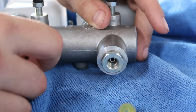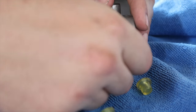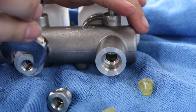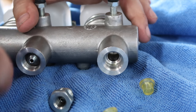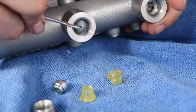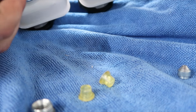Another thing: if you are running disc in the front and disc in the rear, these master cylinders have a little check valve. You just have to remove it and throw it away — you don't need it. There are two of these on this side; this one's on this side, this one's on that side, and no check valve on that side for some reason. So that's fine.